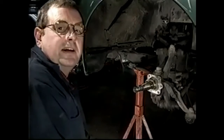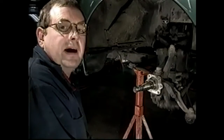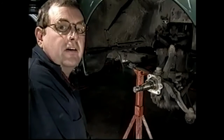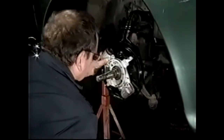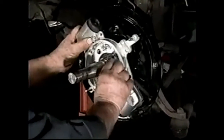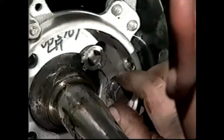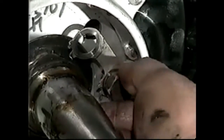Seen us, we've completed the left rear wheel. We went on and we did the right rear wheel. We're now going to do the fronts. I'm going to fit the backing plate to the stub axle and the hoses to the bracket on the shock absorbers. Going to put the lock tab and the bolt. To wiggle it around a little bit. Get the bolt started.